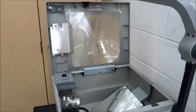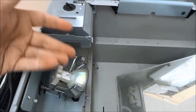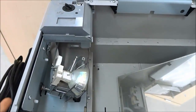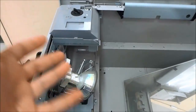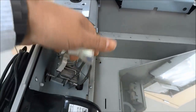The next step is to locate the light bulb. Here is the light bulb that I will be replacing. You have to remove the light bulb — with this one I can just pry it upwards to remove it, but with some overhead projectors you might have to loosen or remove a bracket. I'm just going to pry upwards and take this light bulb out just like that.